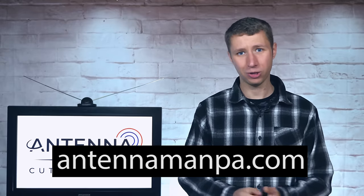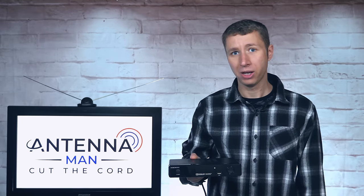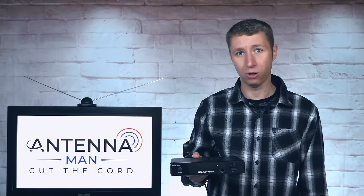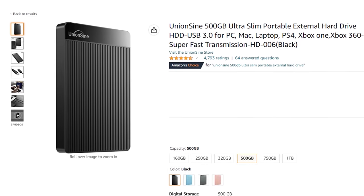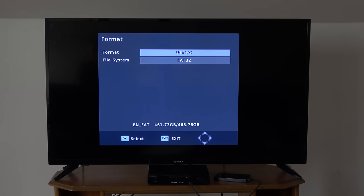If you don't think your antenna setup is good, definitely consider signing up for my antenna recommendation service on my website. Now I'll get to the DVR portion of this DTV box. You will need to connect a USB hard drive in order to use it. Some have said you can use a USB 3.0 flash drive, but I found they aren't always fast enough to record the large file sizes of an HD video file. I would highly recommend using a USB hard drive instead. Before using the DVR feature, you will need to format the hard drive. Go to the menu, scroll over to USB, select PVR Configure, and then Format. Once the hard drive is formatted, you're ready to start recording programs.